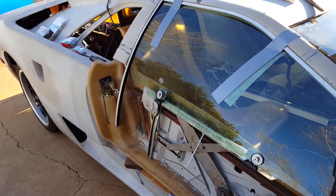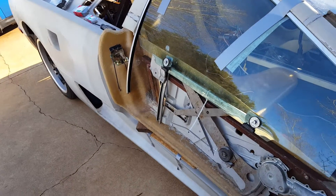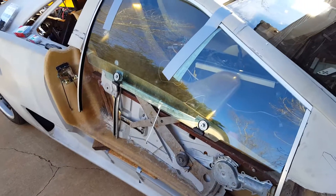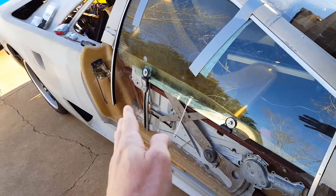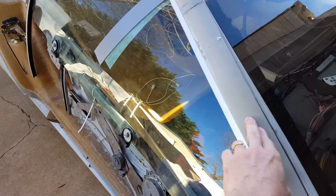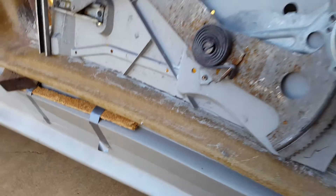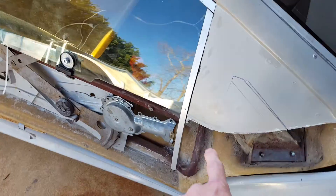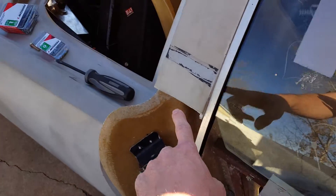So the door latch is in, as you can see over there. This was the piece I was talking about — after the door was hung, hinged properly so that it strikes a straight line and can be latched, the next thing was putting the door skin back on and drilling rivets into it so that it would hold its position. There were also rivets drilled in down low to know where the bottom of the door would go once the door skin was cut away. So I used a tool and cut that out away from both sides of this thing here.